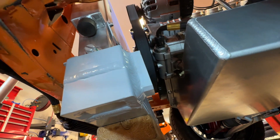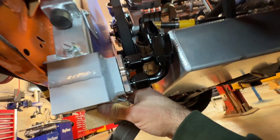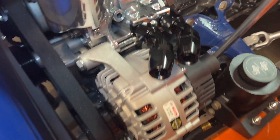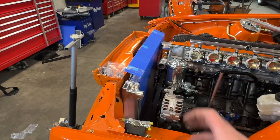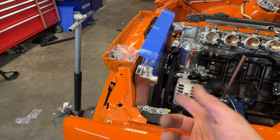This is going to be tricky because the oil pan is going to be in the way, but we'll face that fact when we get to it. It is close, but it fits — look at that — about 4 mils of spacing. Once this is installed, I think this is going to be good. These two lines are then going to snake up to right here — they're going to go out to 45s and those are going to go down to those two lines down there. The lines for the oil cooler are relatively straightforward and we'll end up doing those next, but we've got to get this radiator installed in its final position first because the lengths of those lines are really determined by the position of the radiator and therefore the oil cooler.